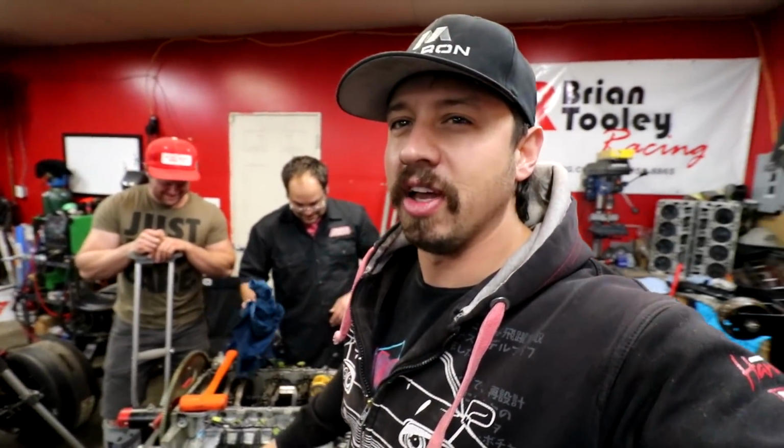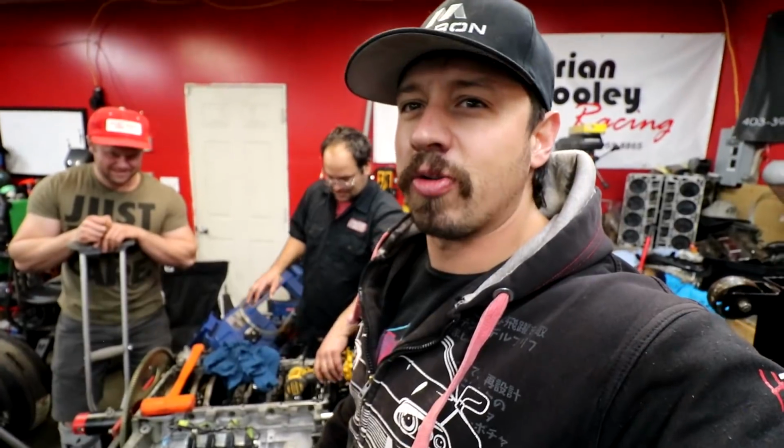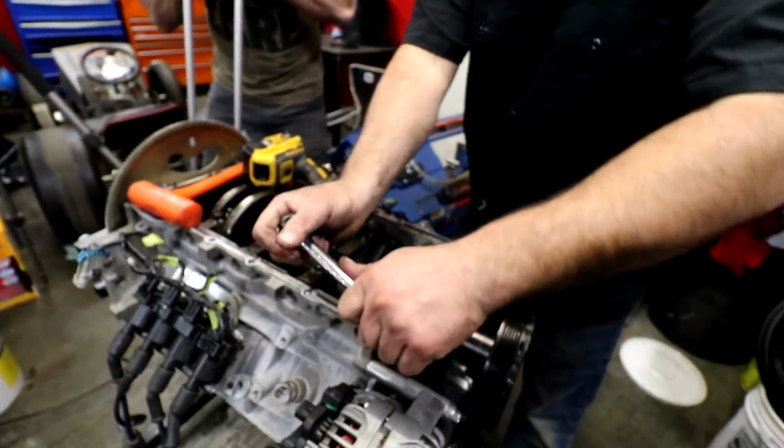We'll basically treat them like aluminum rods. The boys change out their aluminum rods every 15, 20 passes, and we just gotta change out our stock rods every 15, 20 passes. Wearable item now, that's it. Let's see if we can go 3 for 3.